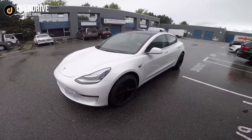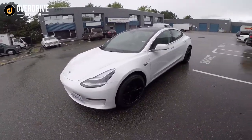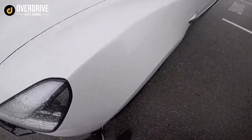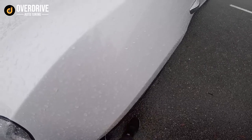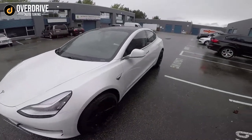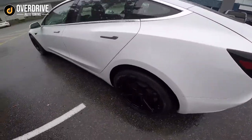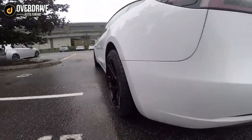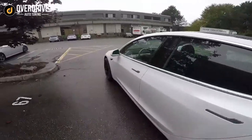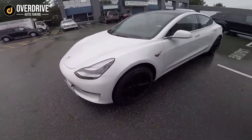It's about almost an inch wider than stock and we put a 265/35/19 tire on there — it's really pushing it to the edge. You can see the edge of the tire sticks past the fender slightly, and the front-rear is pretty much flush. The rear looks basically perfect; I wouldn't bother adding a spacer. The front could do with a little bit more camber to bring it in nicely, but this is stock suspension and stock alignment.